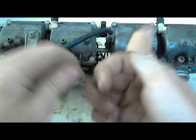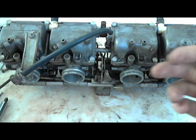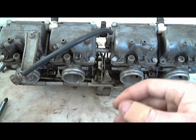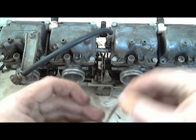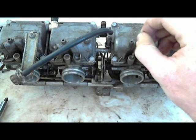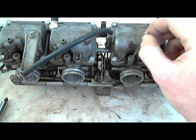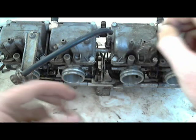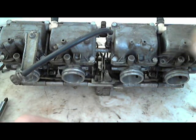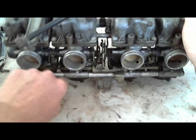It's just a cap, and this one is about 3/16 of an inch thick. I took my drill and a drill bit and drilled down into it. It's a brass cap. I kept pulling it out about every 10 seconds of drilling until I started to see a little hole appear at the bottom, meaning that I'm almost through, because I don't want this to go all the way through and risk damaging my little head on the idle air adjustment screw.